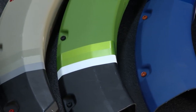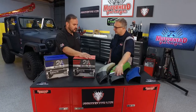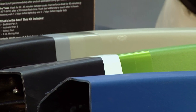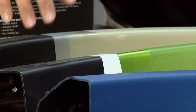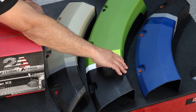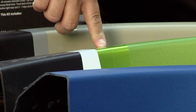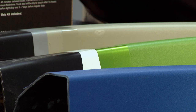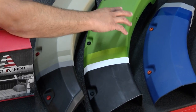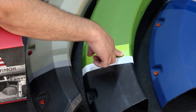Let's talk about the different kinds of finishes you can get. This is what the base fender or stock fender would look like. So basically if you bought a wheel flare and wanted to add it to your vehicle, it's going to come in raw plastic. You would put a sealer or primer on it, base it, you could clear coat it. This emulates a factory clear coat finish, and then you can tint our color. You can see that due to the texture, it looks very close to the base coat, if not exact.